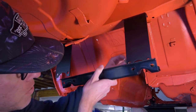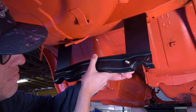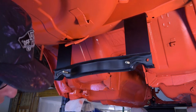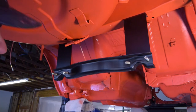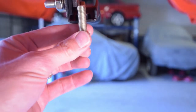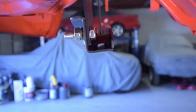Now we're going to continue with the bottom of the transverse mount link. We want to angle it so we can feed the bolts through the back and get all those placed. Then feed in the flat washer and the lock washer and hand-tighten these down. The reason we put the bolts in this position is that if we didn't, when we tighten up the transverse, this bolt would run into that bolt. So placing them this way lets us bolt these up and get them set.